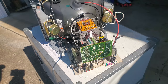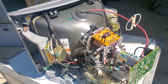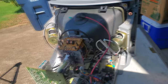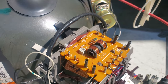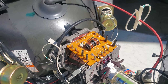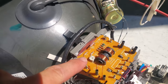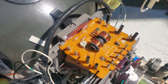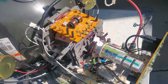Here's a look inside the KV CRT television. Notice that the build quality is very good — this TV has some things I normally would not see on just a consumer set. First off, we're going to look at the deflection yoke, and this is a pretty unique deflection yoke that looks almost like something you'd see in a professional video monitor. You'll even notice a potentiometer on here that allows for some convergence controls.